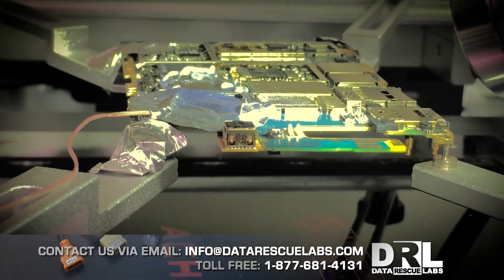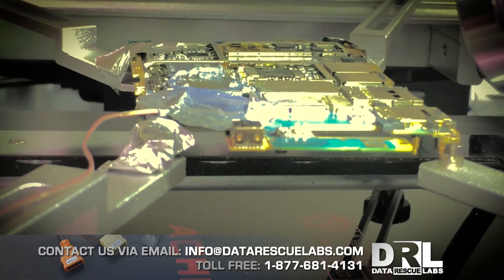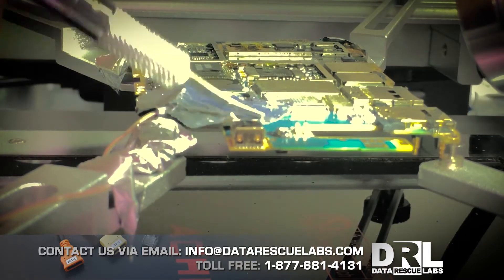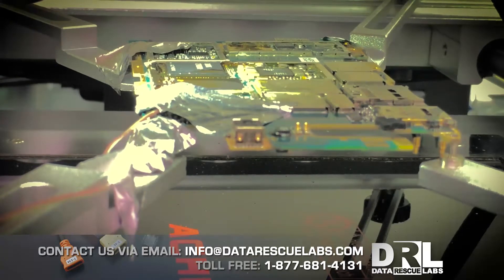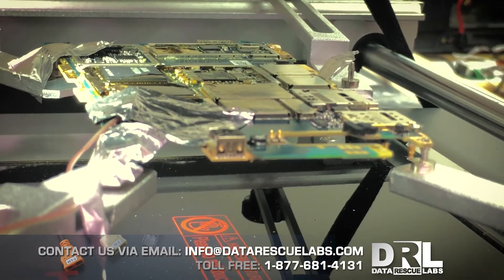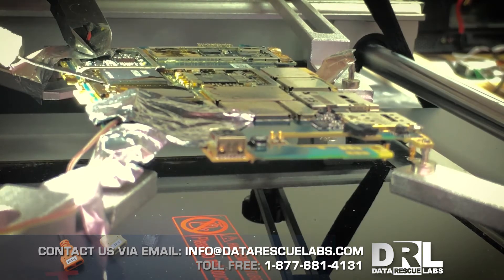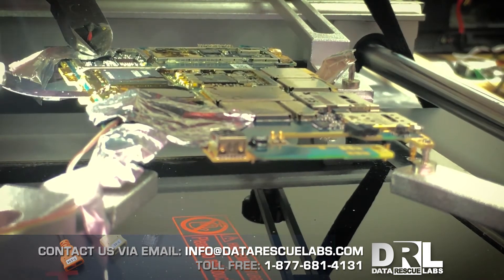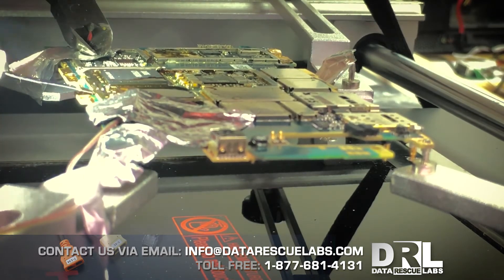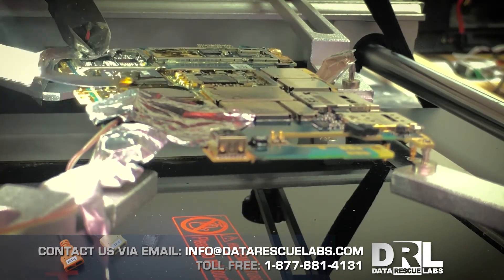This is the best shot I can get of the actual board because the heating element is very close to the board. You can see the flux is starting to melt. The first thing I want to try to do is remove the underfill on the edge here — I'm also checking the CPU to see if it's moving — but first things first is to remove all that underfill so I have a clear path to go with my tool right underneath the NAND chip.